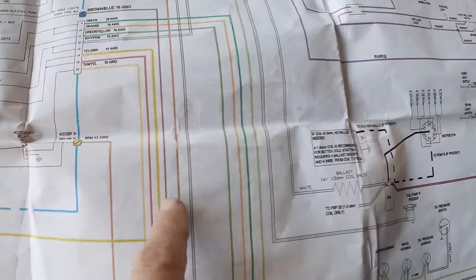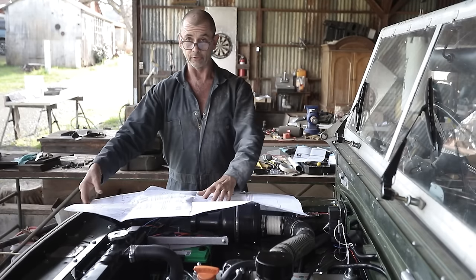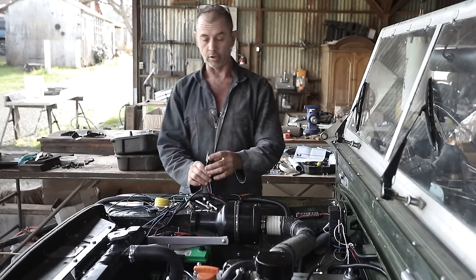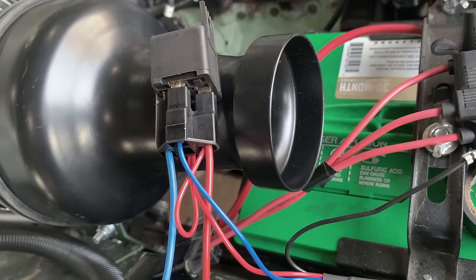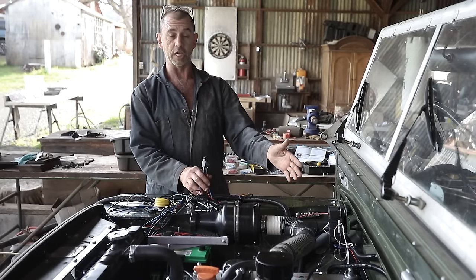we see that it runs from one side of the fuse box to the other and incorporates into the spare relay. The manufacturer asked me upon purchase if I wanted the spare relay to be positive or negative actuated, and I think I chose positive, so it's probably not going to work for us. However, the fan controller comes pre-wired with its own relay, so I think we could chuck the hot straight into fuse 15 and be good to go.